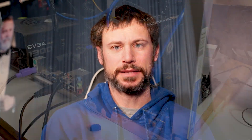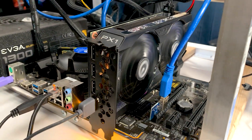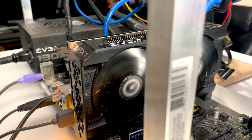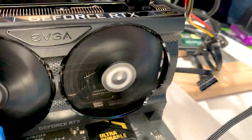At first when I started testing it, it didn't work for me, but then I did get it to work. I did a little more research, looked at some comments on other YouTube channels, and found out there were a few things that needed to happen. I had to move the graphics card on my rig — I couldn't have it on the riser, so I had to take it off the riser. As you can see, it's on the motherboard now in the normal PCIe X16 slot.